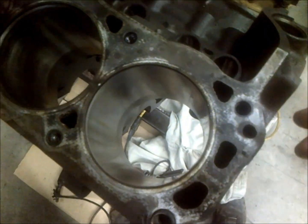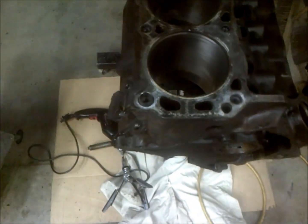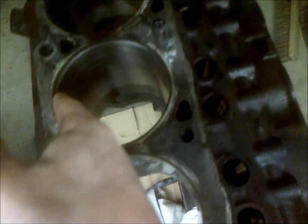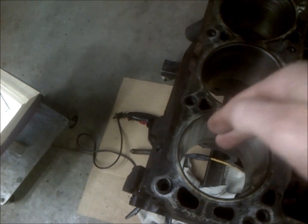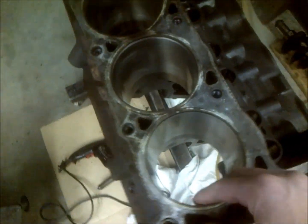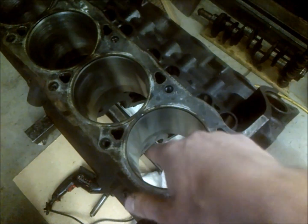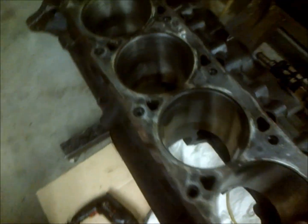Go a little bit at a time with your hone. You're really more deglazing the cylinder wall so your rings can reseat. If you have to actually hone it significantly, you might as well bore it if it's that bad — honing won't fix any dramatic lip. Go up and down at an even pace to get all up and down the cylinder wall evenly. I might go up and down about 30 times, then stop, wipe it off, and take a peek. I'll do another 30 times, and at that point it looks pretty good — but when I check with my tools I'm not any farther overboard than when I started.